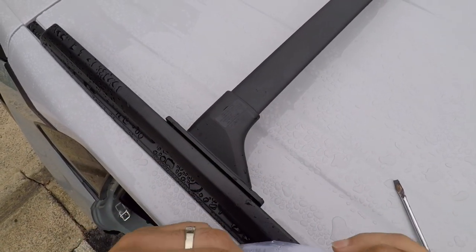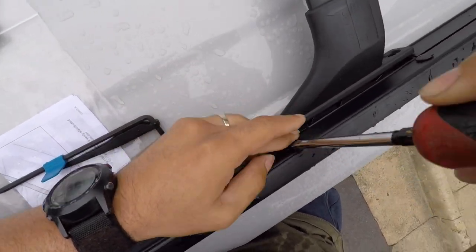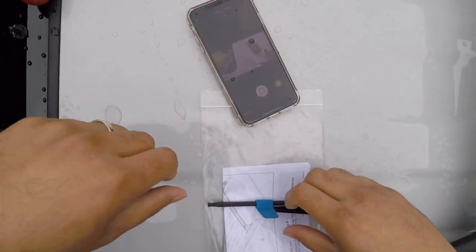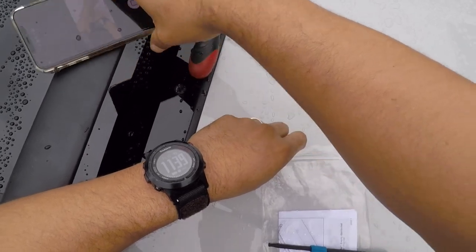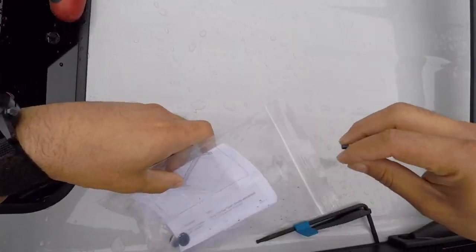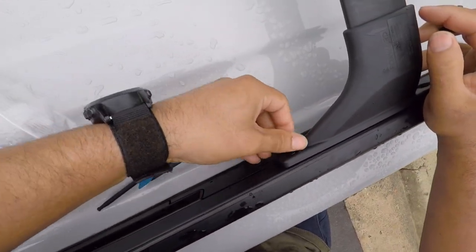Now we're starting on the rear end — I already took the plastic covers off. Here we go to the other side, and here are the little plastic covers I was talking about. You just pull these out with a flat head screwdriver. Make sure you don't go ham on them so you don't scratch your paint. Put them to the side because you're going to hold on to those for later use — if you need to take those crossbars out you might want to put those covers back on. Now get the last of the hardware and again, hand-tighten in the back the same as you did in the front.